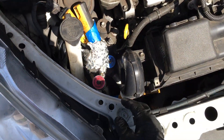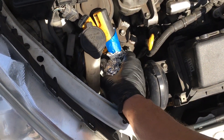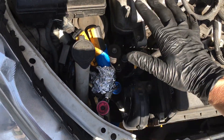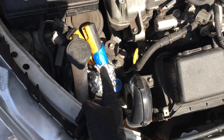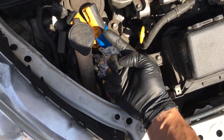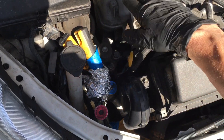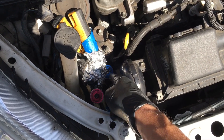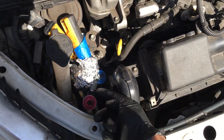The tape and aluminum foil are just to keep the gauges steady and prevent them from flopping around due to engine vibration. On extended road tests, as you shift gears the engine moves around, and that vibration will work the nuts and caps off the gauges.